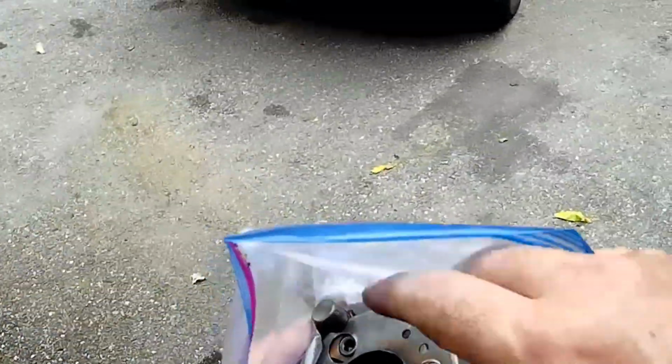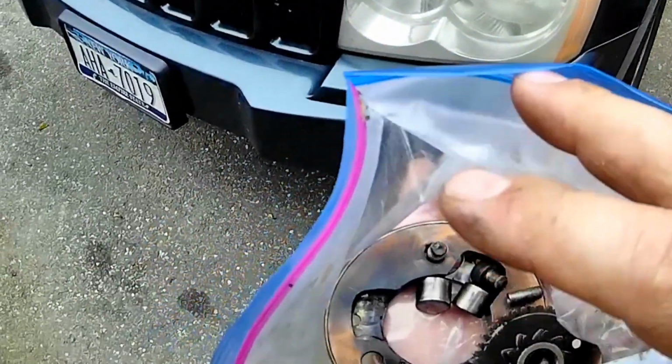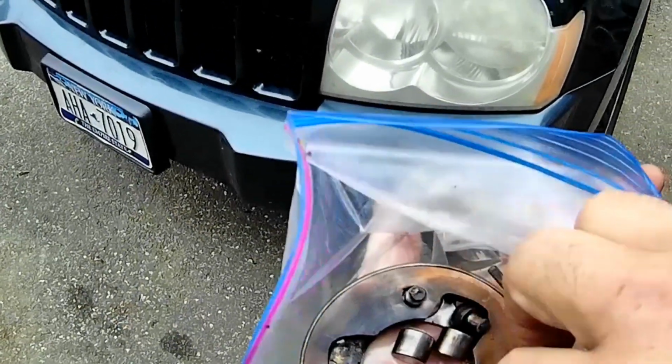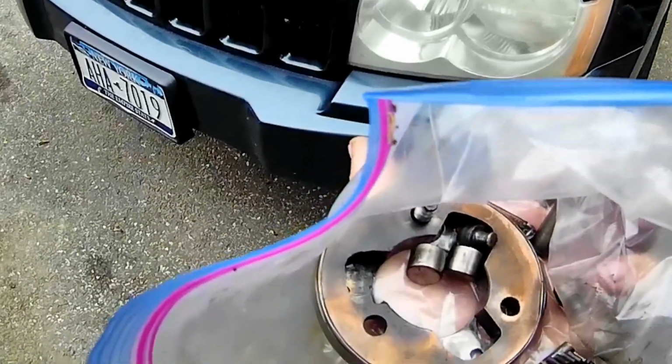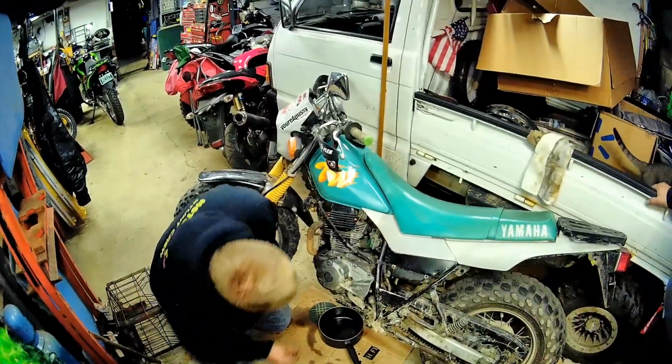That's it. So this is a Sprag style clutch where the bearings roll into the center to grab it, but they'll let go. Only lets it go one way. Back together and order the parts. He ain't ordering shit.